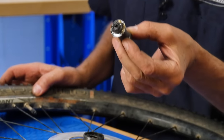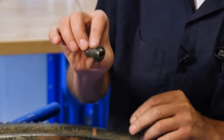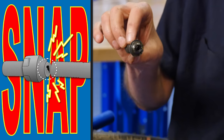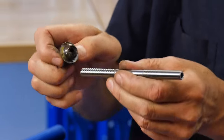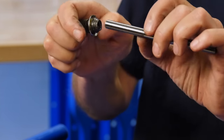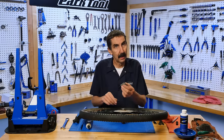A quick release — not the kind you want. You want a new axle. We can see you're ending here. When you ride the bike, there's a little stress right in the threads. So that's where this one failed. Not uncommon.